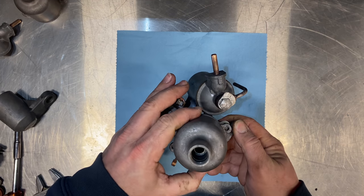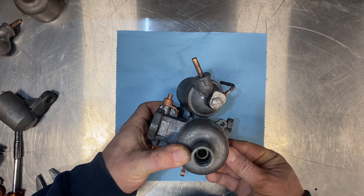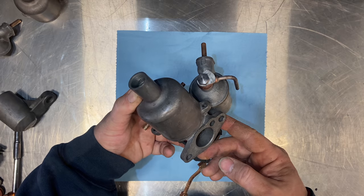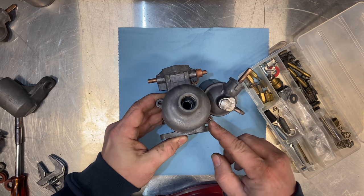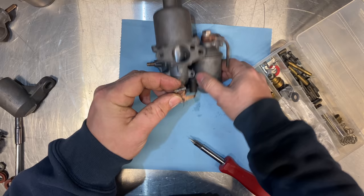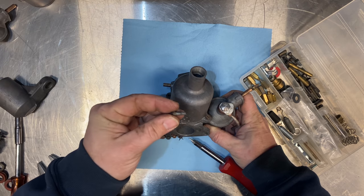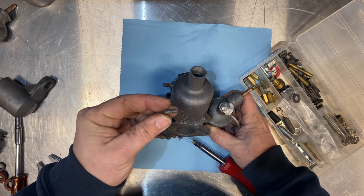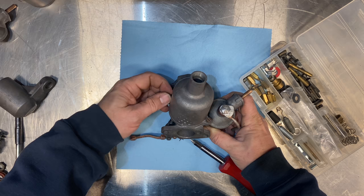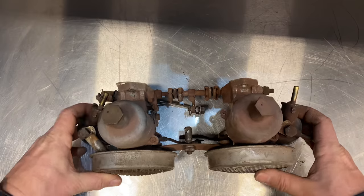If I return it back to the original position, these are such finely machined parts that the piston works correctly. It's important to test all the parts as you're putting them together. Also remember — when searching for a replacement screw for the dashpot covers, those are a Whitworth thread. Don't go trying to shove any regular screw in there; the threads will not be the same.